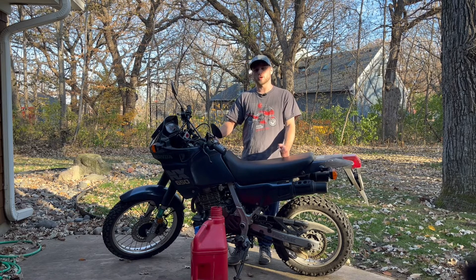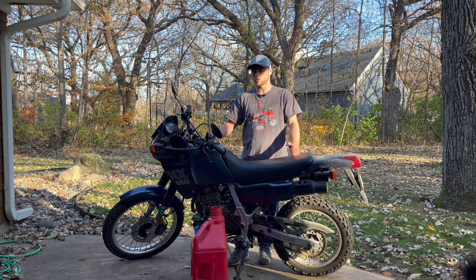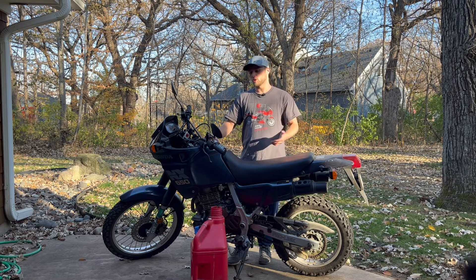We had some foresight with running this bike. We've gone through the carburetor on this once. We kind of do that with pretty much everything that comes through the shop that's going to be a riding motorcycle — open up the carburetor, clean everything out, clean those pilot circuits, clean our main jets, clean our emulsion tubes, get everything where it needs to be. That'll be another video at some point, but we've done our diligence. We've done this bike right, and now we want to keep it right.